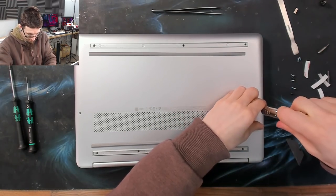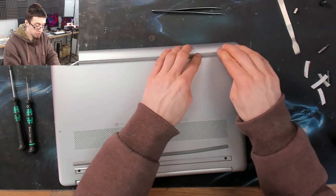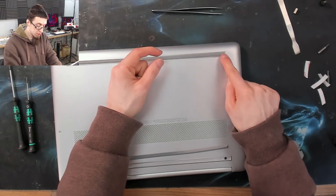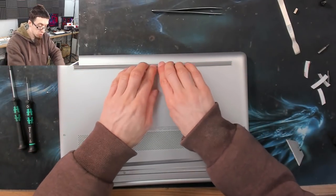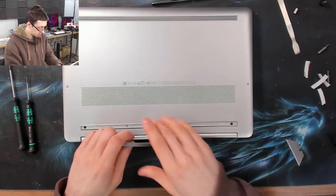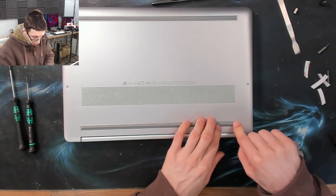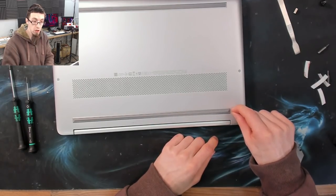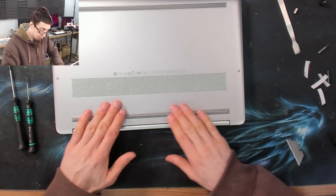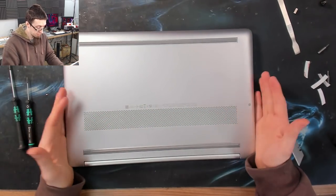Everything is plugged in and we're ready for the battery and back cover. When putting the back cover on, have a quick look at the ports on each side to check if you need to hook over anything — sometimes you need to come in at a big angle to hook over the ports and then swing it down. Go around and get all the clips, then in go the back screws. Refit the rubber strips — if one has stretched a little, tuck in both ends and compress it back into the channel.